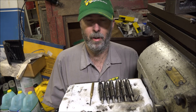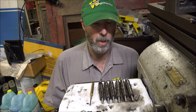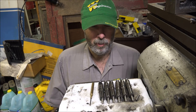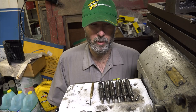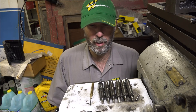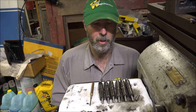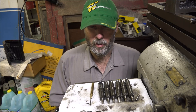That's going to do it for the at-home budget builder injectors — how to put them together, set them up, pop test them, and even flamethrower test them just to have some fun. These nozzles all checked good. One of them was dirty out of the box; had to take it apart, clean it, and blow it out to get the chatter right. After that it chatters just like all the rest — all spraying good, atomizing nice, and ready to go in the truck.